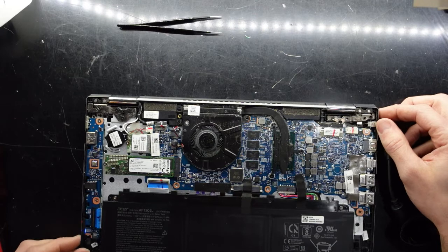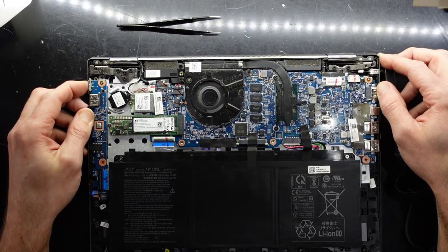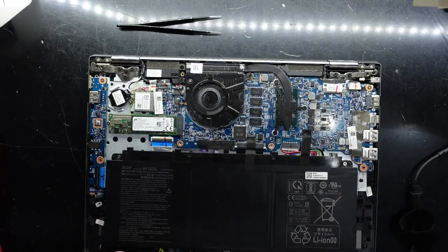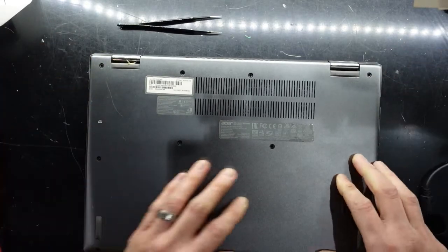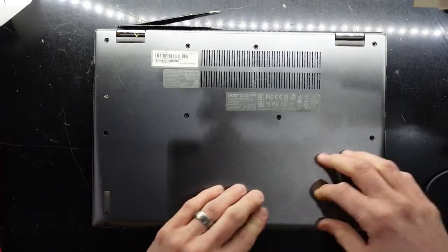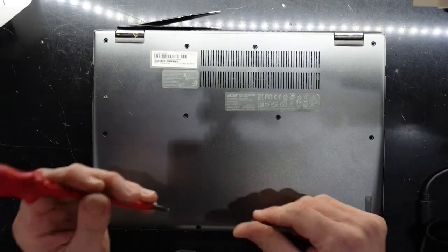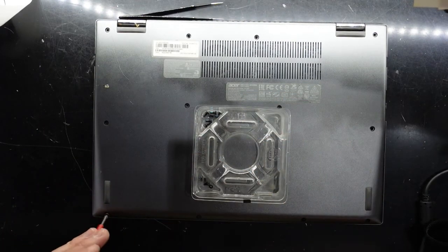It's a good reminder not to always assume — find out for yourself what the problem may be. The customer said their laptop wasn't powering and they'd tried a different charger, but turns out if I'd tried a new charger first I probably wouldn't have had to tear this down. You also wouldn't have got to see the inside of an Acer Spin SP513-52, which as we found out is not very upgradable — you can change your M.2 and your Wi-Fi, but you can't really change much else. Little screws, big screws — I hope this helps with your teardown of your Acer Spin. I'll put these screws back in and catch you guys later. Bye.